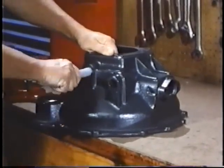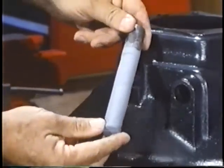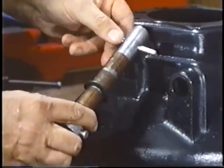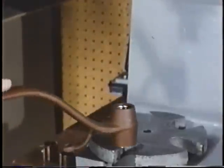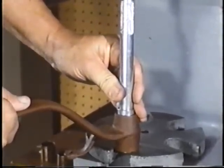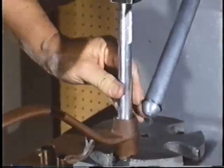Let's start with the brake pedal and the pedal shaft. Probably the pedal shaft will be worn, like this one, and it should be replaced. Good reproductions are available. Also, the brake and clutch pedals should be re-bushed. This can be done with a hammer and a bushing driver, but a small arbor press is nice.